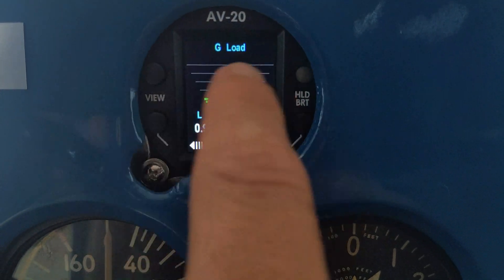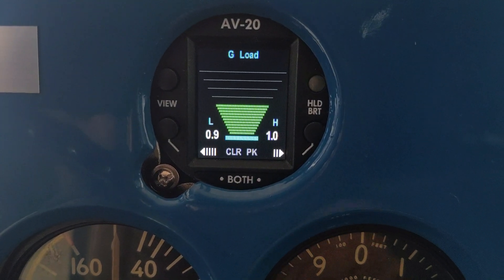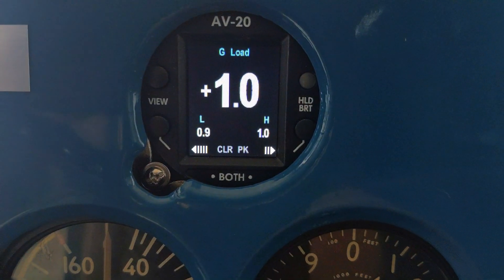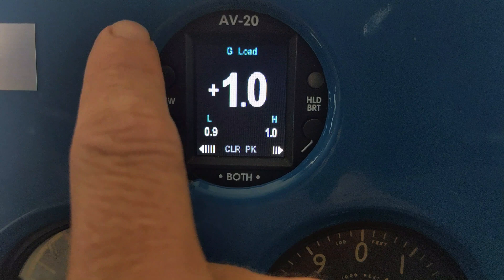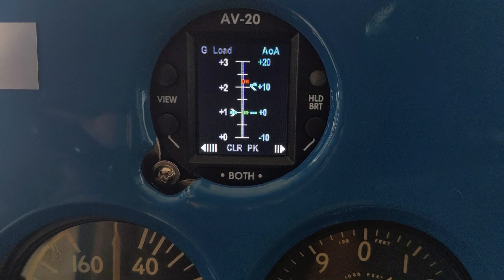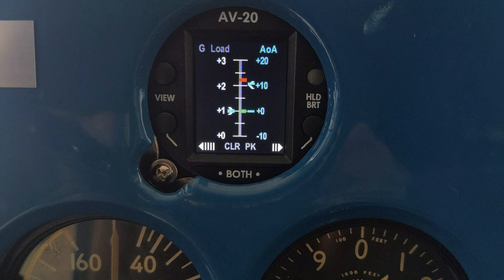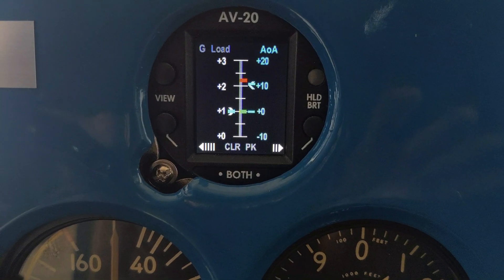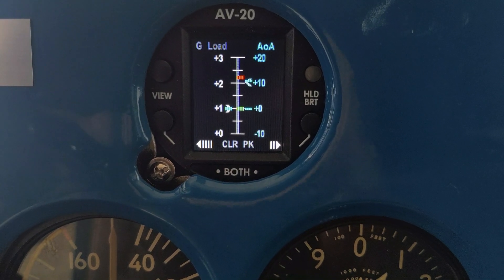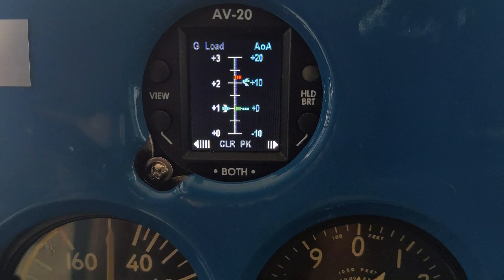In the angle of attack menu I also have a G-load. Like any G-meter it tells you your high and low for the flight. Right now we're 0.9 to 1 — just a digital readout of the G-load. This is the max G-load in the angle of attack. This is really useful for setting the angle of attack: you set your highest angle of attack, and then it figures out the green range, the cautionary range, and the stall range. You need to go up and do a stall to figure out at what angle of attack your aircraft stalls.